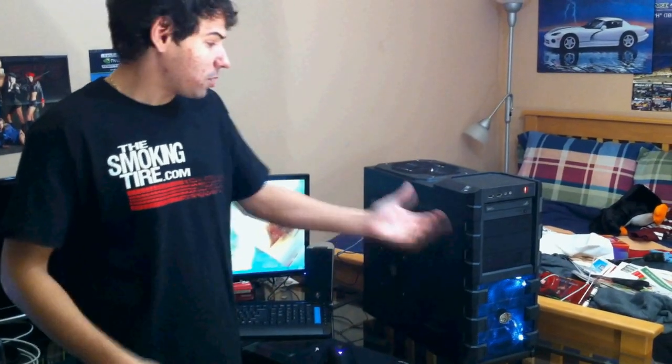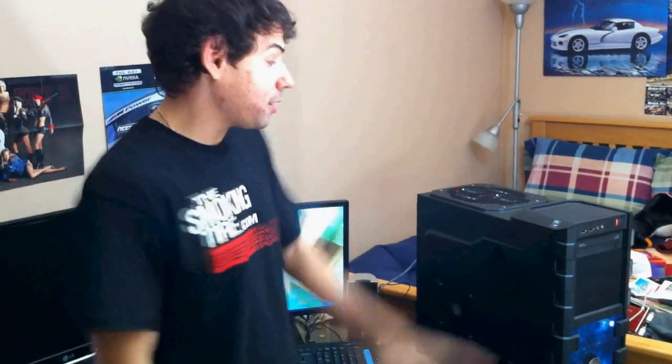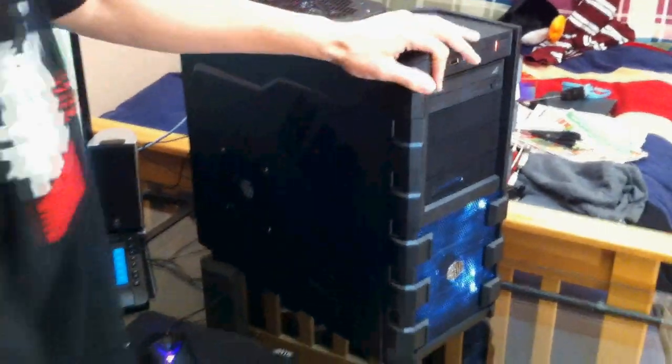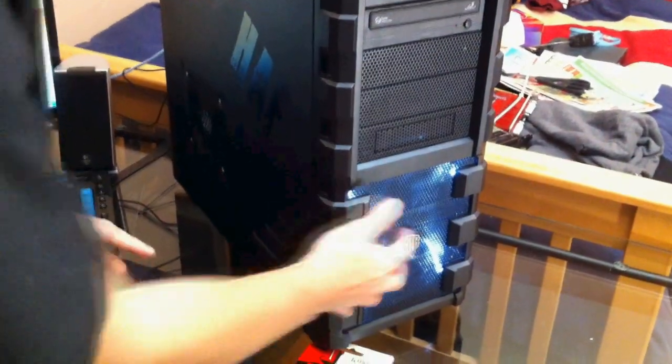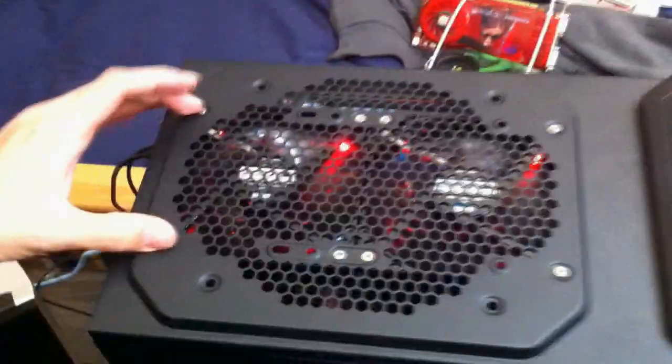So it is a little noisy and a little more audible, but it's all good. Stick around — we'll be checking this one out in a bit more depth, but if you want to check out the specs and all the benchmarks, check out our other video. The only difference between this one and the other one is the power supply, case, and the fans we used. The first fans were Yateloons; now we're using Cooler Master R4 fans, which spin at 2,000 RPM — they are a little noisy. The Cooler Master HAF does not come with a 200mm fan, so I put a 200mm white LED one in. We also added a DVD drive and two R4 2,000 RPM fans. Both of these fans push 90 CFM at 19 decibels, according to Cooler Master. I took the front fan the case comes with and put it on the side to blow cool air on the video card.